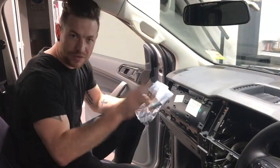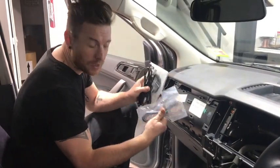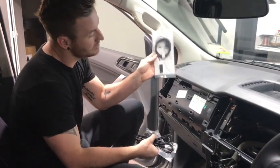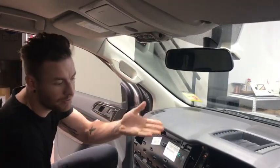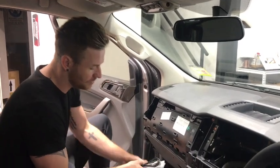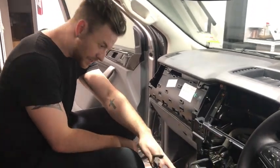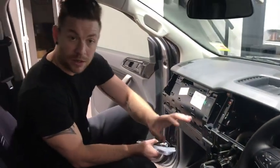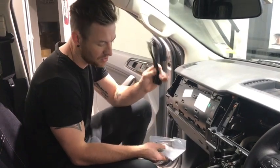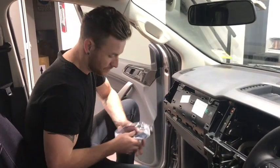Now we're back in the car. We've done all the physical mounting on the bench and we're going to show you all the wiring. We have a few peripherals for this Kenwood deck: a DAB Plus on-glass antenna we're going to mount up here, an external microphone for clear voice calling, a couple of USBs since this unit has two — putting one in the glove box — and we're going to retain the factory USB and auxiliary in the center console. We also have a GPS antenna for better navigation when using Apple CarPlay or Android Auto.